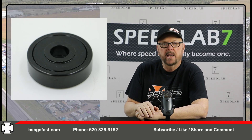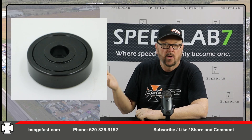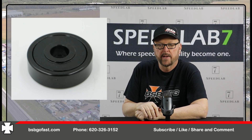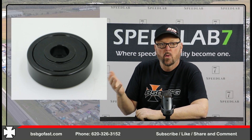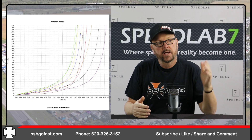One other thing we use is a gland saver — it's a bearing swivel gland saver. It allows for load, especially from a bump spring, to come up to the end of the shock and have some rotational value in it. It keeps from damaging the shock and possibly trying to unscrew the shock. These are waterproof and they are bearings, so it's a very good piece for taking load off the end of the shock. It can be used on a bump spring or possibly even a donut-style bump when it creates a lot more load. Foam bumps, in my opinion, are some of the more popular bumps — once you understand the chart, you'll find it very easy.